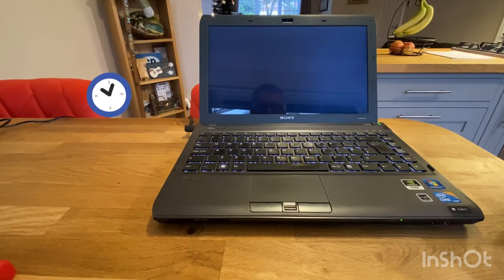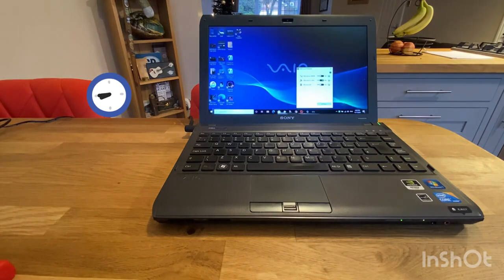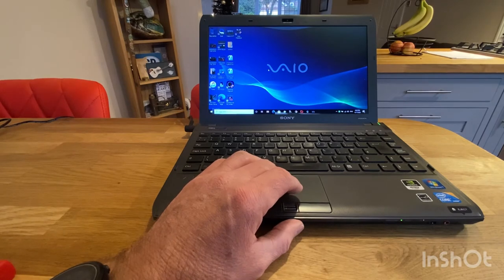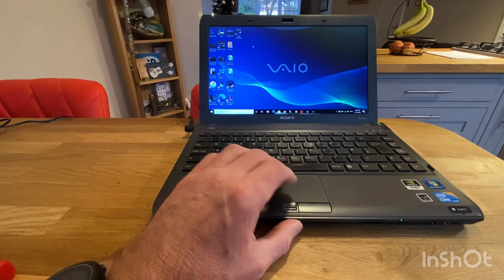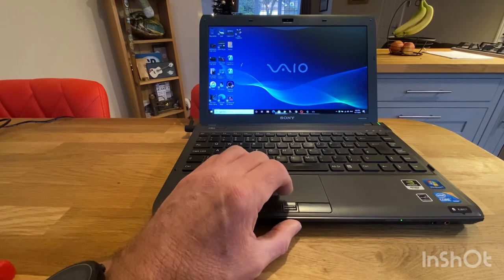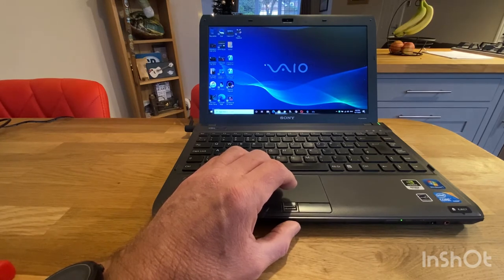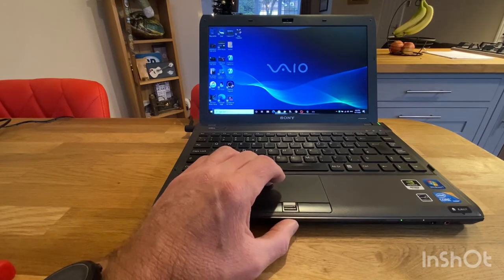Something's happening — that's a good sign. We're in and it's played the Windows startup sound. That normally took about three minutes 40 and it's done it much faster than that — I'm happy with that. You can't hear any sound from the drive at all because there are no moving parts. If you're putting a Samsung SSD in, you need to download the Data Migration app and Samsung Magician from the Samsung website. That data migration app works fantastic — it's basically created a mirror image of the old drive.